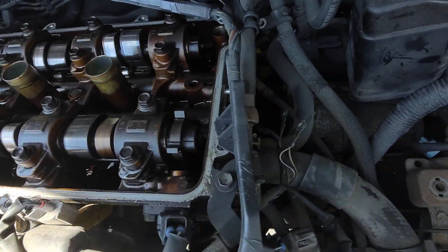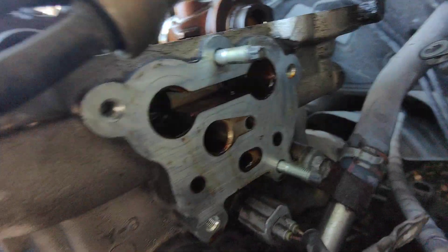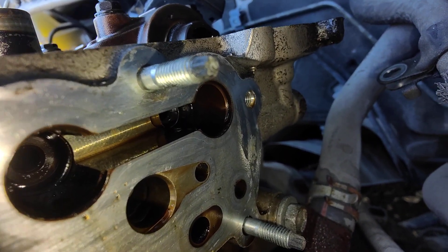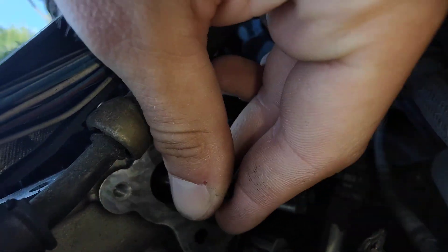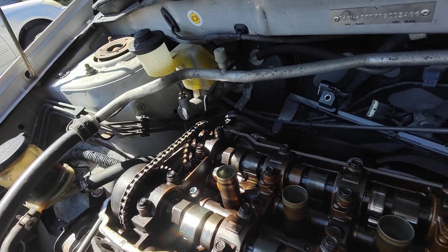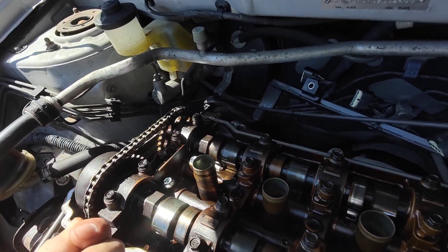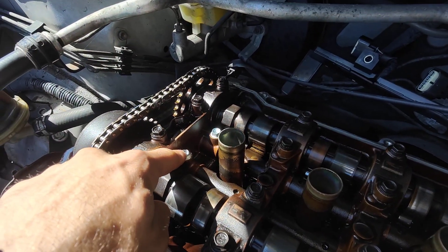You can see that there's a hole right in there, and you put your socket extractor inside and turn it — it's a left-hand thread. Once it bites, it actually turns the pipe, and then you can find your broken bit. Once you take the bolt out, if you see a nice smooth metal surface and not a rugged one, that means the bolt has broken and the tube has turned. So you'll need to turn the tube all the way up, centering it so you can see it perfectly, and then it's accessible to take the remains of the bolt out.